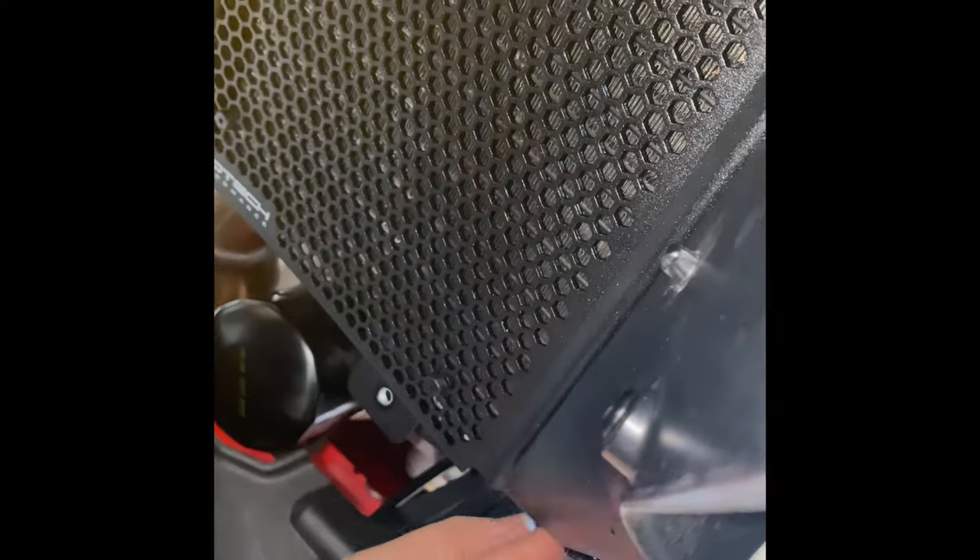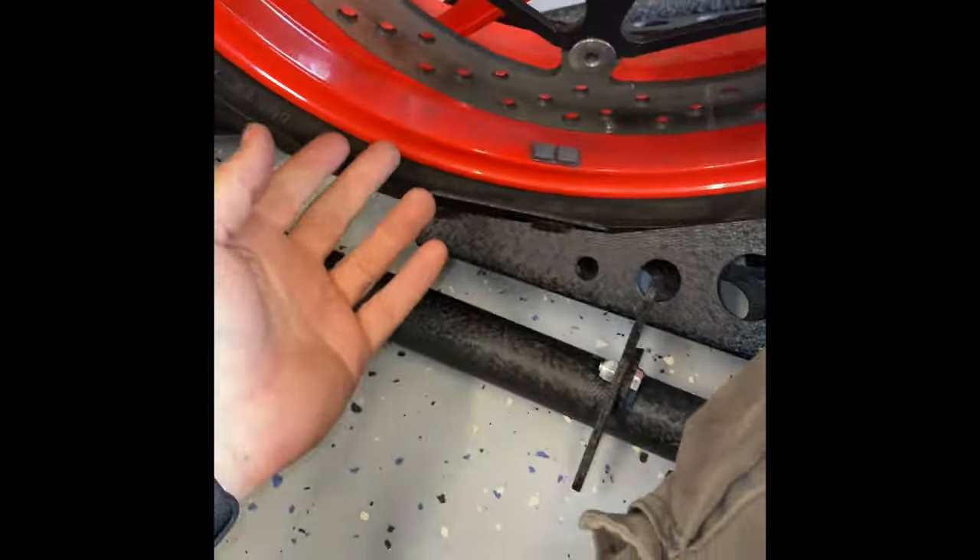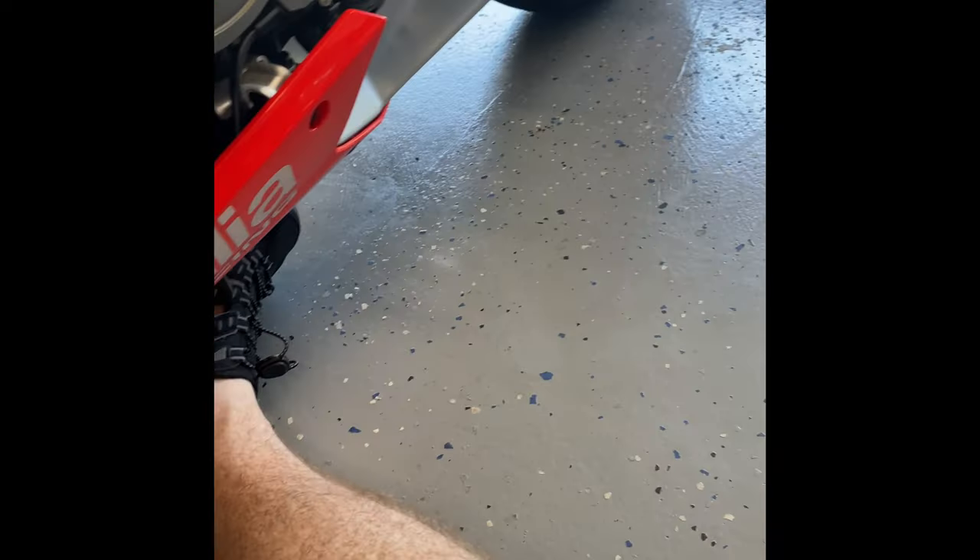One, two — the third one's up here. When you screw it in, check right here that this piece is flush with this piece. To get around this, what you want is a good short three-millimeter allen wrench for up in here. Otherwise, you can take it off a vice or just rotate the wheel the other way and get it out of the way — that's probably a lot quicker. That's all there is there.